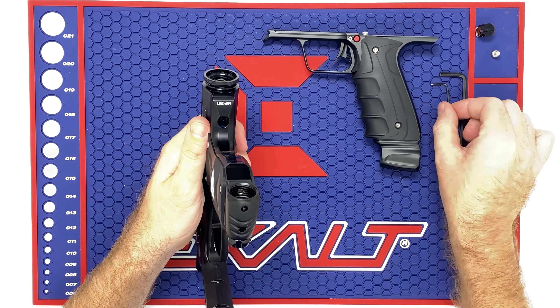There's a little plastic mounting bracket on the solenoid that actually comes off. If it accidentally comes off, the correct way to put it back in is: there is a round cutout that sits against the body — against this tube here — so make sure that is facing up. There are a couple of little plastic clips in here that just hold everything back in place, so it just snaps in. Make sure you have it in there correctly. The correct way to verify this is to make sure that plastic piece is facing down towards your table if your gun is upside down.